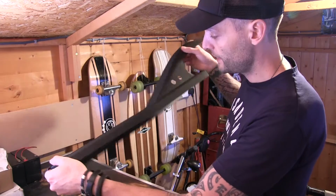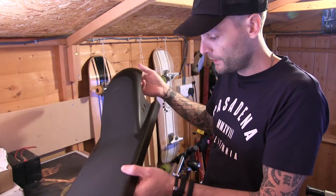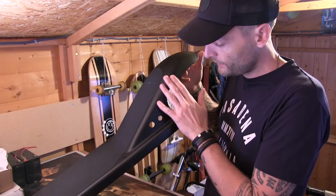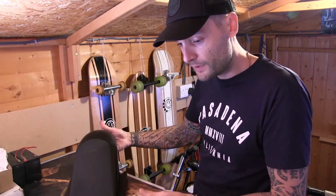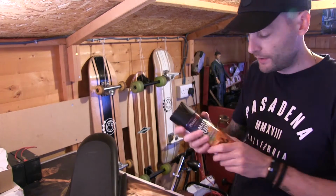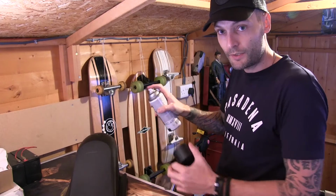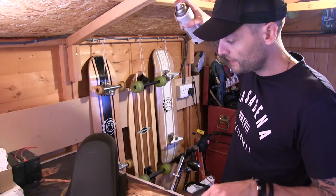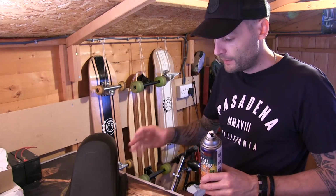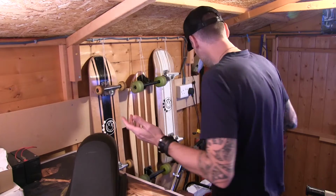I took the pleasure yesterday of spraying up my frame, my fairing. Remember we called it a fairing? I went for more of a matte black than a matte satin, and I wanted to go with a textured style when I sprayed it, textured as you feel it and when you look at it. The way I did that was to spray the fairing holding the can of spray really far back. Rather than 8 to 10 inches, when you would normally spray, I was spraying right back, and basically it was kind of dusting as it went on, and it dries almost like dust on top. I just wanted to go for a different look really, and I'm quite happy with that, so it looks pretty cool. It probably will scratch really easy though.